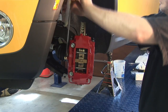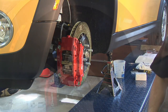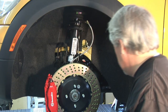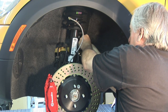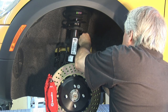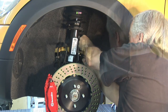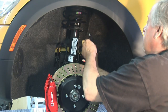There we go — we've got our brake line installed and our caliper installed. Things look like they're going to turn freely. Now that the caliper is installed, we're going to refit the brake line — our new high-pressure stainless braided brake line. Get the rag again on the cup because we're going to take the bleeder cap off. Get this hand tight, put it up through the hole into the flare nut. This fitting on the bottom is a 15 millimeter rather than the 17 millimeter from Mini — go ahead and tighten this up.